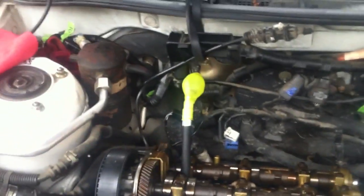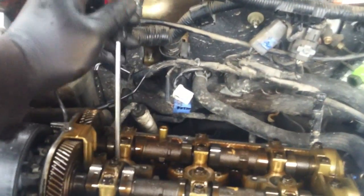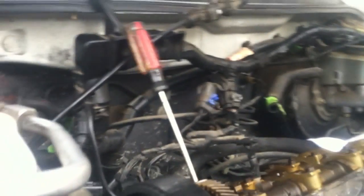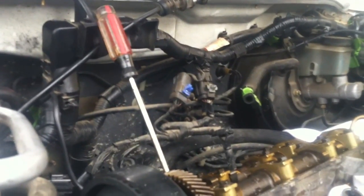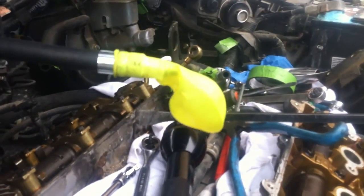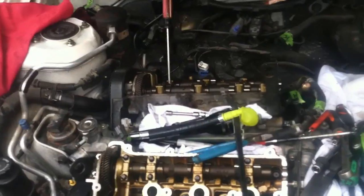And that's how you find your compression stroke on any vehicle. As you get to the top while that balloon is inflating, stick the screwdriver back in there. Make sure you're at the very top — see how it's going back down? Bring it back up. Top dead center is right there, on the compression stroke. The balloon told us we're on the compression stroke. It's that simple — don't overthink it. Get your hand tools, homemade tools, balloon, screwdriver, hose rigged up, and handle it.